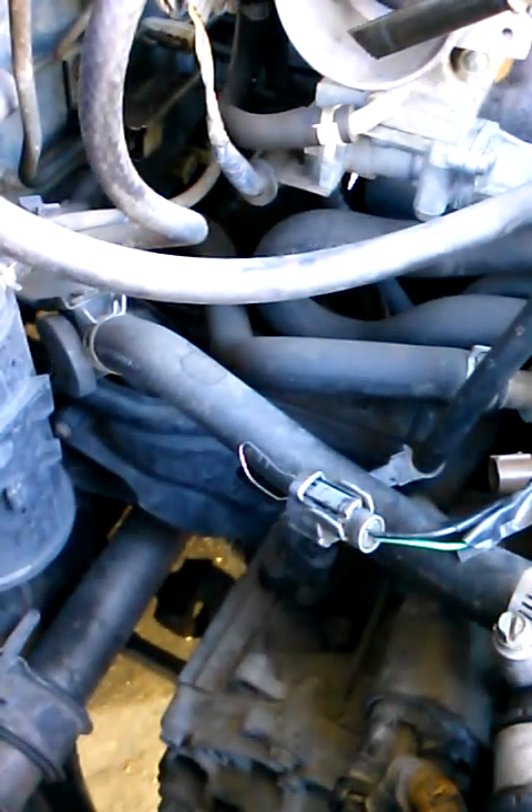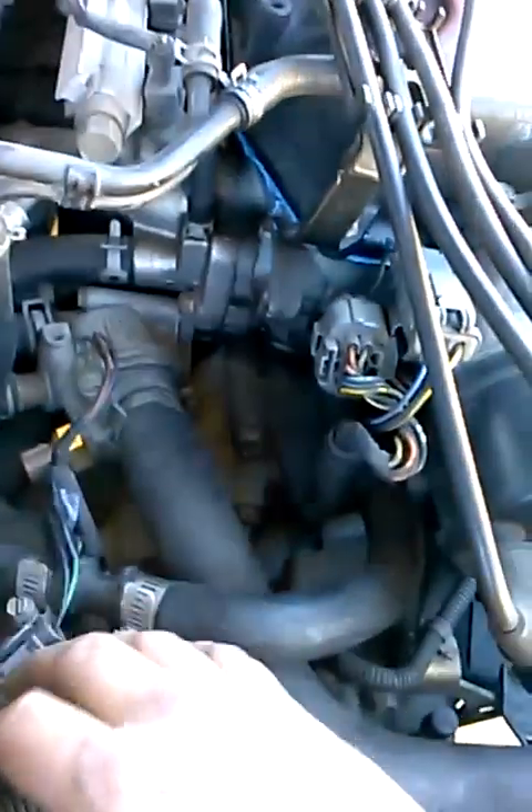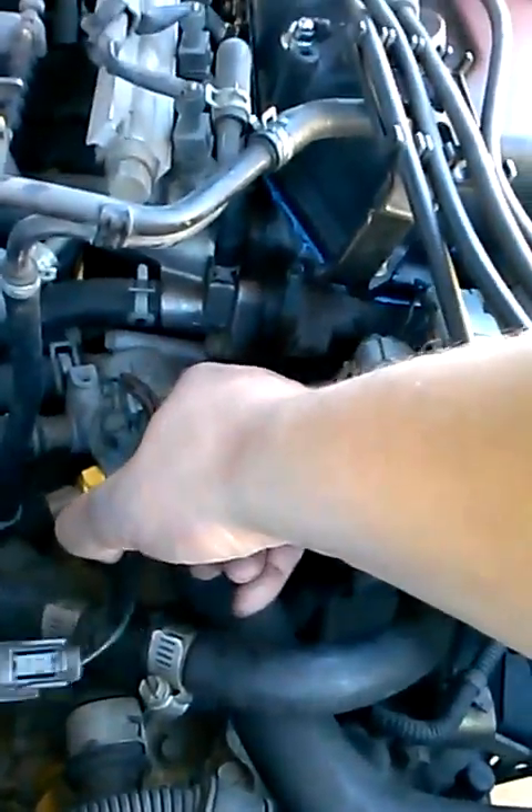All I did was turn the key on the ignition just once. With the connector shorted, the fan is running — that means the relay is working properly and the fan is obviously working. The last thing to check would be the cooling fan switch and then the thermostat.